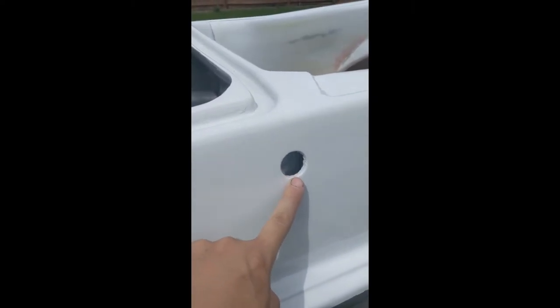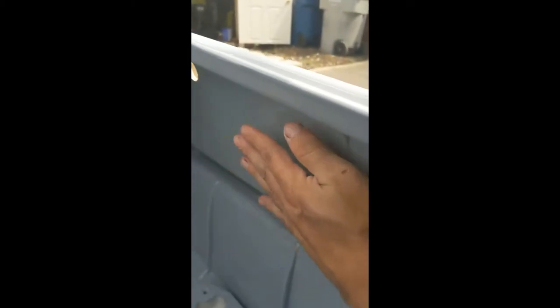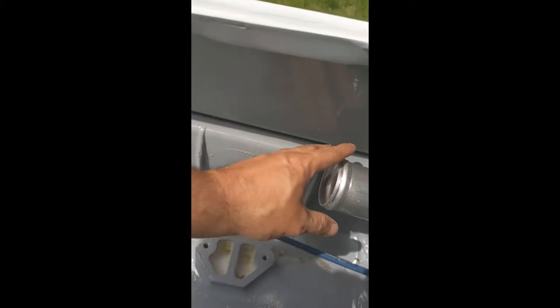This is kind of the standard area for doing a bilge outlet. So from the other side, you basically want it just as far back as possible, but enough to have some room for you to kind of crank it and remove the screws in case you ever need to remove it. So don't put it at the very far back so that it's annoying. Also, you don't want to do it too far forward because it gets in the way of your exhaust. And you'd have to route the hose all the way back to the bilge because you want the bilge sitting in the back. You don't want it on this side because it's going to be in the way of your exhaust outlet. So really the best place is right there.